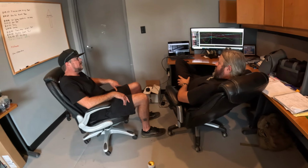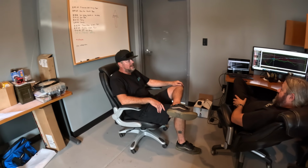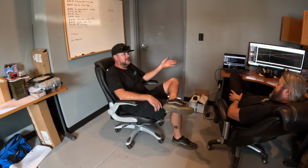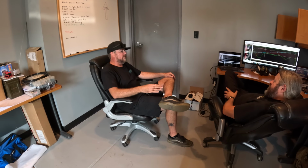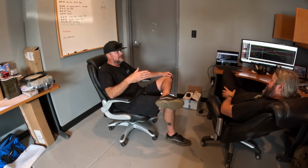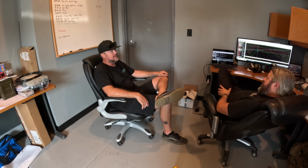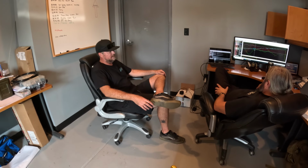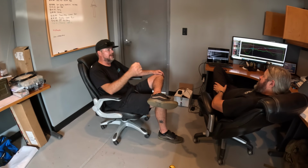The only issue with it doing that is the way I've been driving the car to save the transmission: I don't clutch after first gear. I just burp the throttle and grab the next gear. The problem is the engine RPM falls so fast, it'll drop down to 5 grand and then take off again. So if it is going to slip at peak torque, I'm in danger of getting it there. Unless we set the car up where I don't lift off the throttle or the clutch, and I bump it into a rev limiter and just let it pull into the next gear on its own.